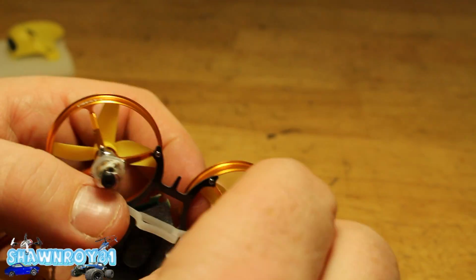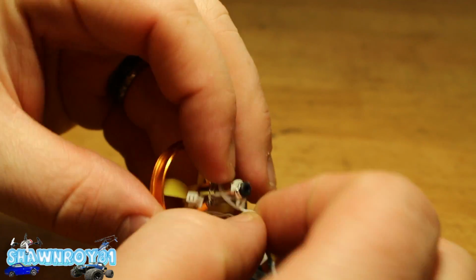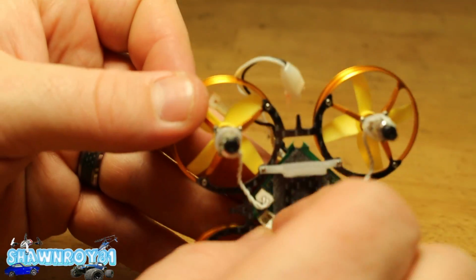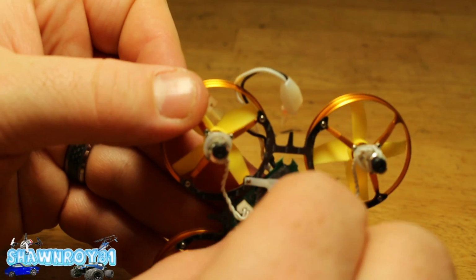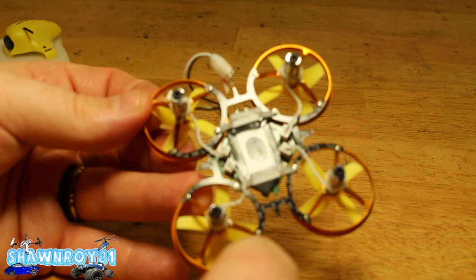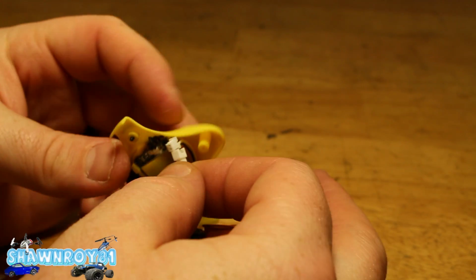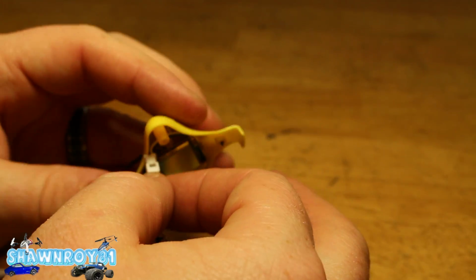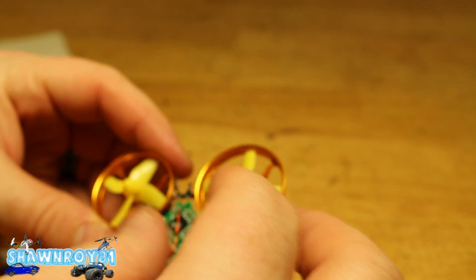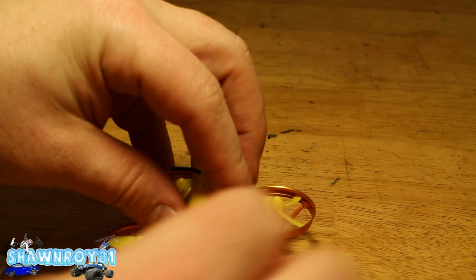Got our next lead here. I twisted it up like that so I'd remember my orientation before I noticed that the motor can had the gray and white bottom. Right, so we're untangled. Final one's in. Done like dinner. So now here, the reassembly of the body portion might be a tad bit different because now our mounting holes are gone. So we're going to reconnect the FPV system to the power. And mock ourselves up here, see where we're sitting.